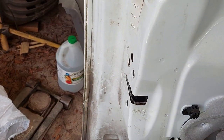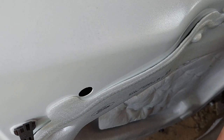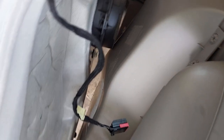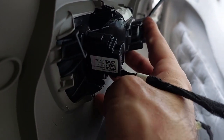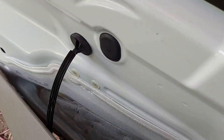Next step, we're going to need to take away the NVH barrier to get at the latch assembly — this lovely quilted looking thing right here. I'm going to stop filming so I can work on all these electrical connectors, getting them loose if possible. There's a connector here that's got to go, and then there's a connector back here I need to get loose. Once I get those two loose, the panel should come free and then I can get the NVH barrier.